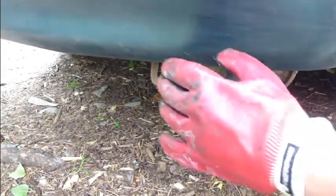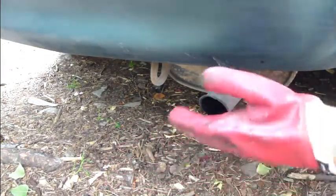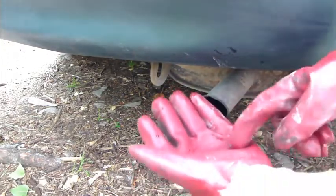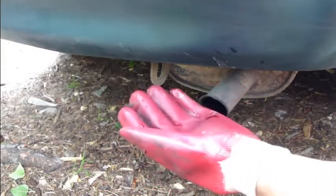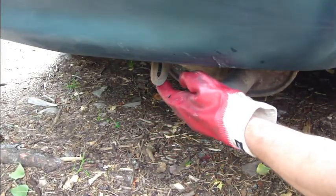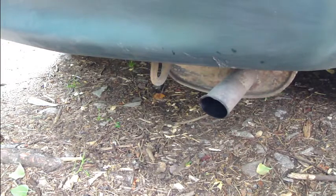Here is my glove. I repeat that test again. Firstly, press hard like this on the pipe and be sure that there are no leaks. Don't use only your bare hand — use a glove, like this plastic one. Press it down and wait 10 seconds, press hard. If the sound happens, your exhaust system is okay.